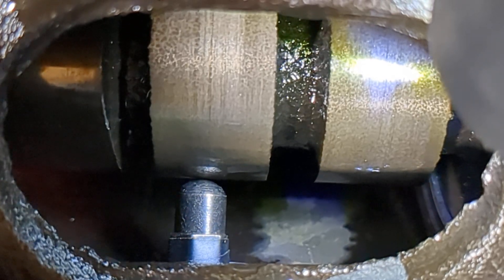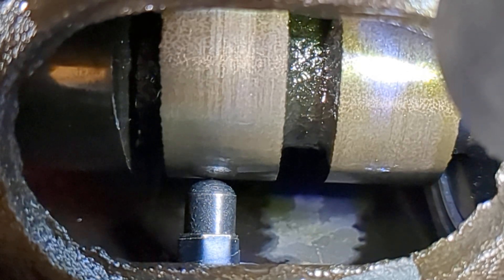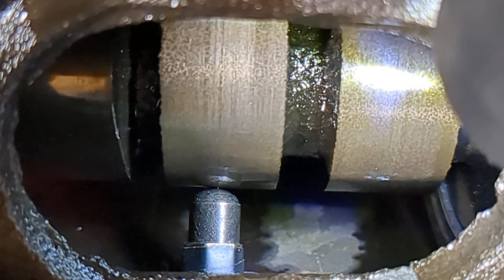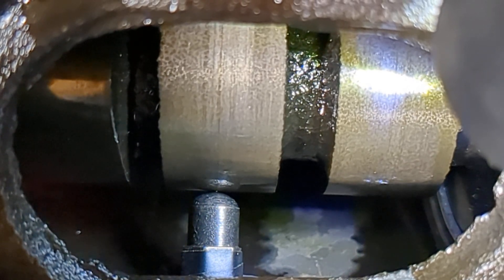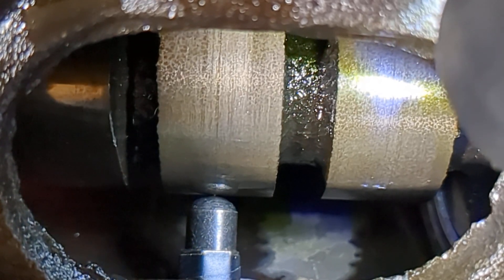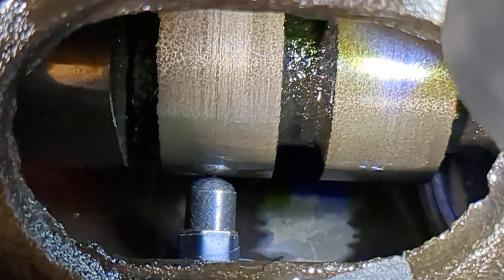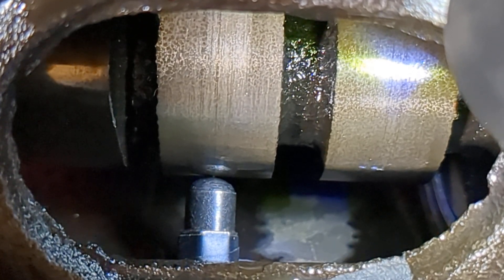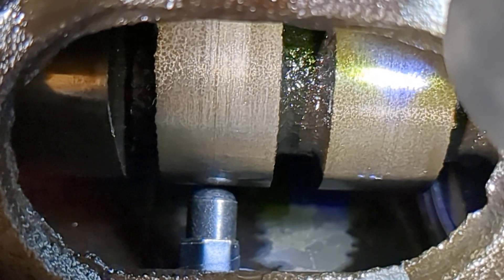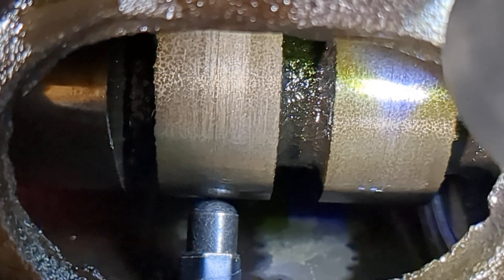Now, some of you are talking about hitting the edge and I'm nuts. Guys, I'm simply showing you that if you go extreme in one way or the other — small or big — it will change the valve timing. It's not changing lift, it's not changing duration. It's changing when it opens the valve in relation to the crankshaft, because your surface area now is so small the cam has to travel further in relation to the crankshaft. This is elementary, guys.